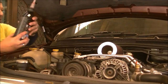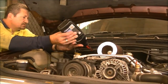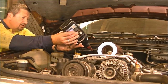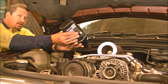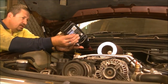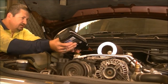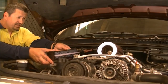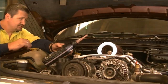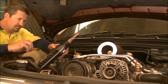You get your bottle, slowly aim it at the dipstick hole, squeeze, let go, keep letting air in it, until it's empty, and you just keep repeating that. This box takes 13 litres, I've got 12, but I think that's including the torque converter. So I'll put 8 litres in and check it with the dipstick, start it up, see what happens, get it on the level and recheck again when the engine's hot, until it reaches the right dipstick height.